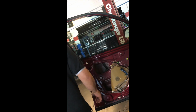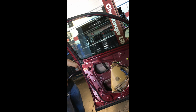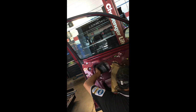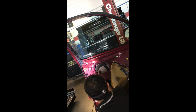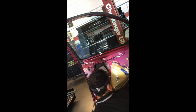Alright, back in business. So it's definitely easier just to remove the key cylinder. It's a T30. You have a hole here, so I use just the T30. It has a bolt that stays in there. You remove the bolt, pull this out. Now we can pull this in place, without worrying about that one, just the handle mechanism. Okay, that's in place. And now let's get the bolts for the outside, which are T30. Put them in the other hand. Alright, place.